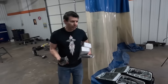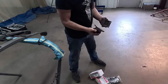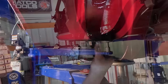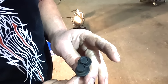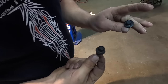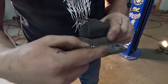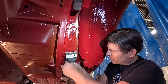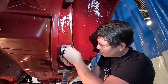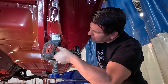Now we're going to install the leaf springs — disassembled and restored. The first thing I'll install is the spring bumpers, the anti-wrap-ups. These mount right here in the holes that Shelby — Shelby American — drilled. These are the actual original bolts that held them, straight from Shelby 1967. They have RBW markings on the bolt, and they use a regular nut — no washer, nothing. It's amazing that rubber snubber survived all these years. All we did was clean it up; it's original.